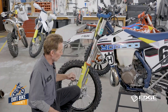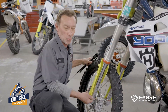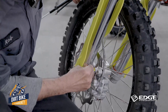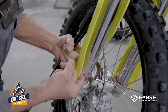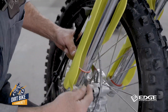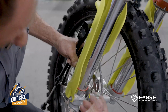Don't just yank the bike out of the shed and go ripping off — you want to set that pressure every time to keep the bike dialed in for you. On the Husqvarnas, there are little telltale rings — these little red rings right here. Before you start your moto, pull one of these rings all the way up to the dust seal. This one's a little sticky because it needs cleaning.